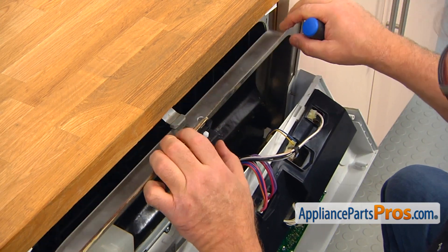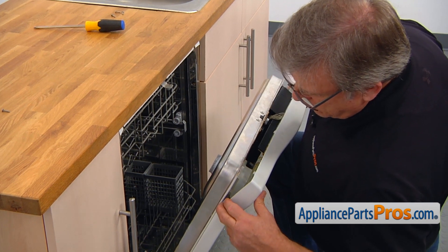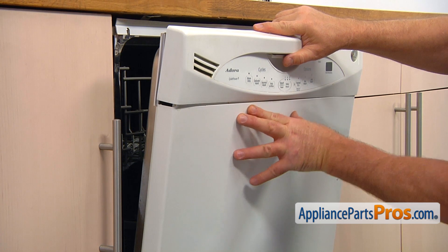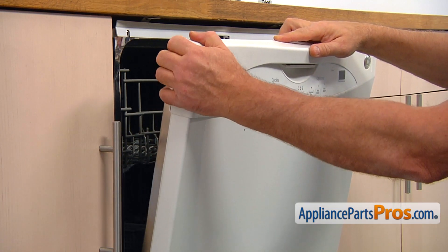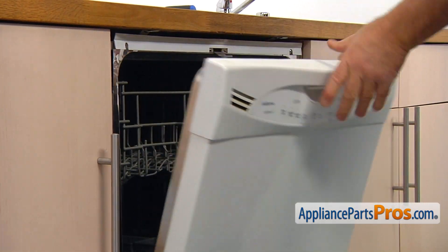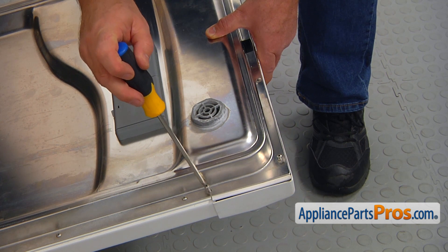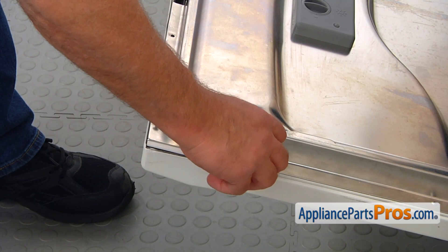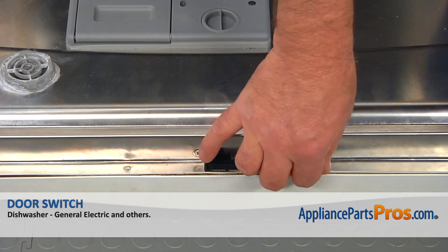It works. Now we're going to install the control panel. We're going to slide that plastic cover in first, then put the right side in. While lowering down the control panel with one hand, push the outer door in with the second hand to make sure it fits into the groove at the bottom of the control panel. Then we can secure the control panel with the screws — installing the first couple of screws on this side, tightening with a Phillips screwdriver, then going to the opposite side to place a couple more screws and tighten them.